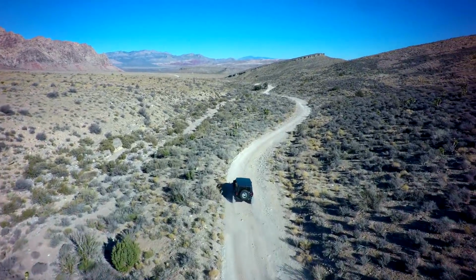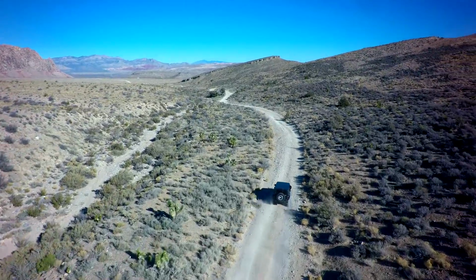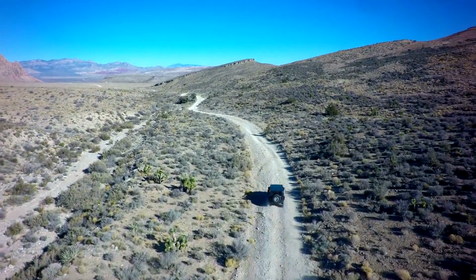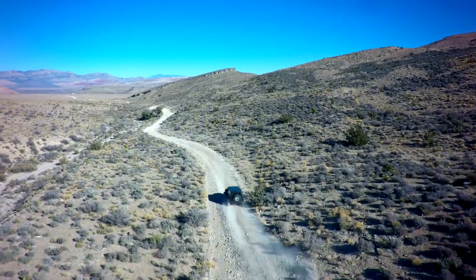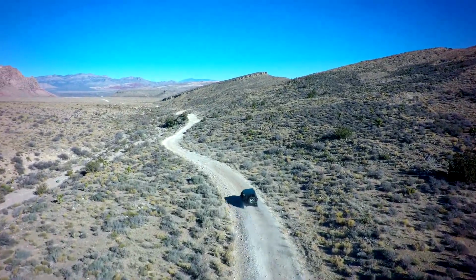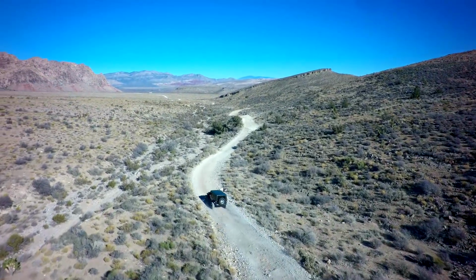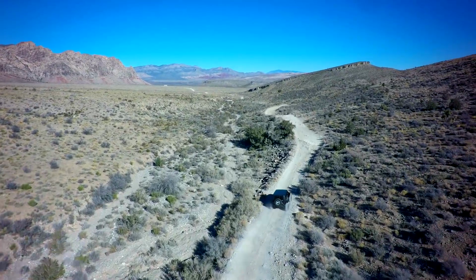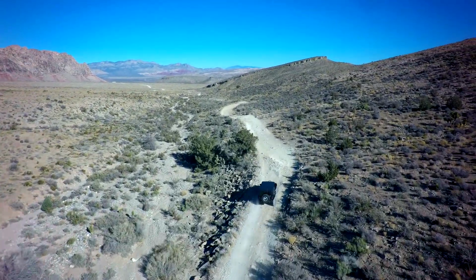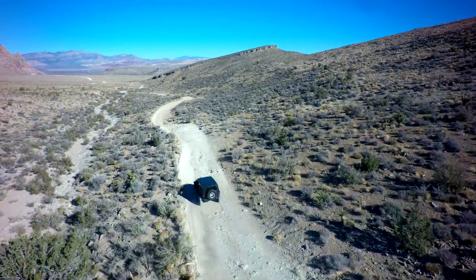Is there an advantage to DOD? Yes. In a light JK that's not lifted, you're going to see some benefit. The first JK we did over 8 years ago is an LH6. That is an early 2009 5.3 with DOD. In that light JK with 32-inch Rubicon wheels and tires, it's not lifted, it does have a budget boost. We can get 20 miles a gallon on the highway, 16 to 17 around town.